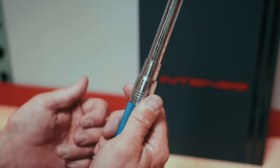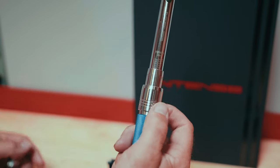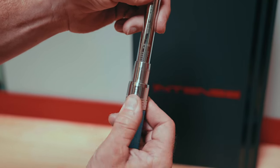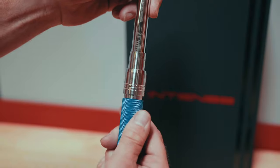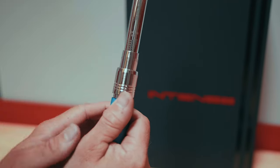If we need to go down — say to four newton meters — we do the same thing in reverse. Starting at zero, pull the locking collar down and do one full revolution to get one newton meter less of torque. Once that collar locks in place it indicates it's in the appropriate spot to the tenth of a newton meter.